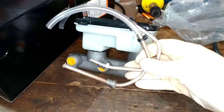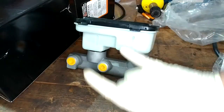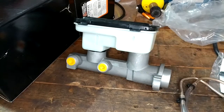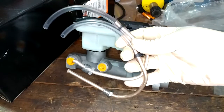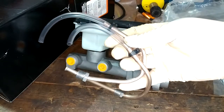As part of doing that, I've made up these guys, which are just lines that are going to plug in here and then loop back into the reservoir on top, so we don't waste any brake fluid and hopefully don't make any mess. This was all made out of basically scrap stuff I just had laying around. And if you've been here before, you may notice that I have a ton of junk cars, so I don't mind having little tools like this in my inventory.